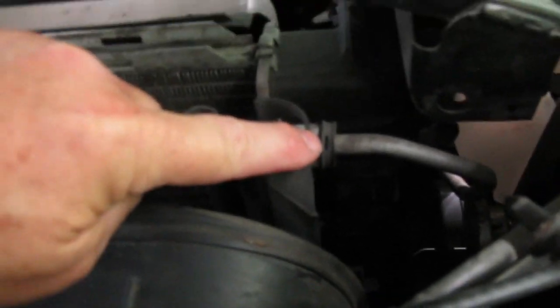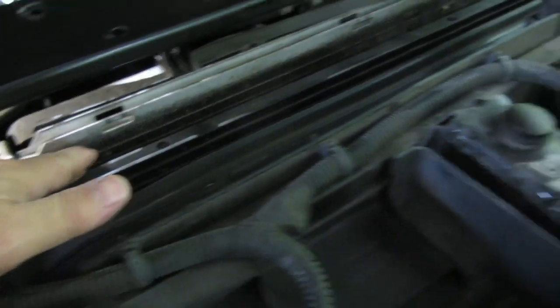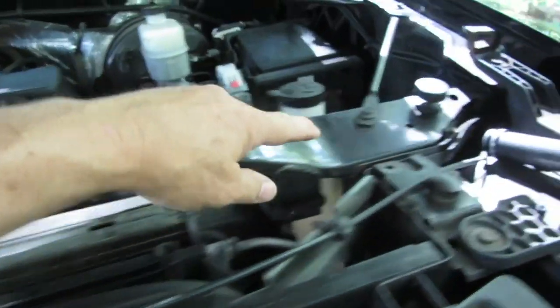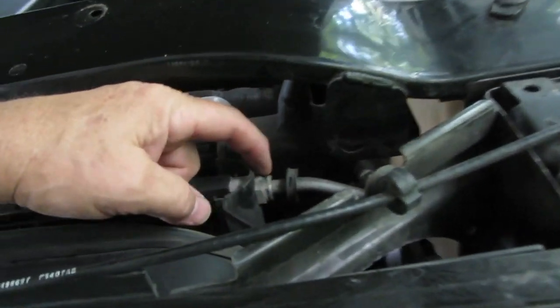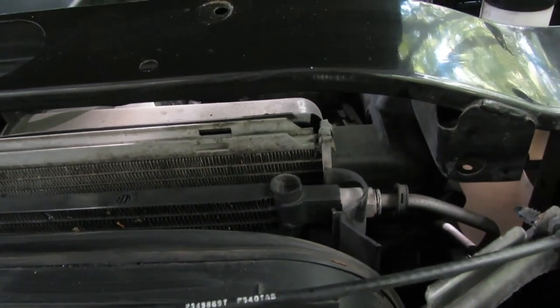This is the input — or output — for the transmission cooler. And if you come over to this side, same thing. So we've got to take those out. It'll probably leak some transmission fluid, which is fine. And then way down there is the input and output for the Freon. So we've got to take the condenser out. This bar is going to come out — we'll loosen this, and this whole bar is going to come out. There's three bolts under here and three bolts under the other side. There's a clip in here — push the clip out and that will pop right out.